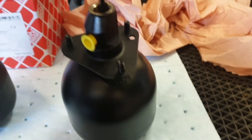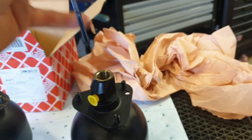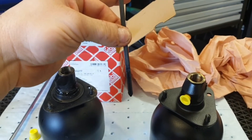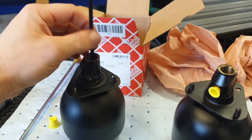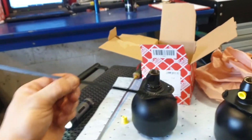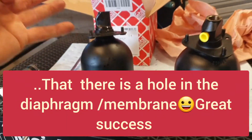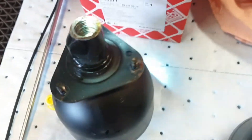Let's find out how far I can push this down. You really have to be careful not to push anything down with sharp edges, so I'm just using a zip tie and guiding it down there. I can stick it this far down — okay, it's blown. It goes all the way to the bottom, so my accumulator is bad. You can see the comparison — the diaphragm is blown.